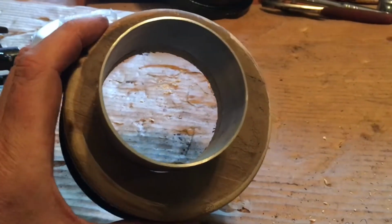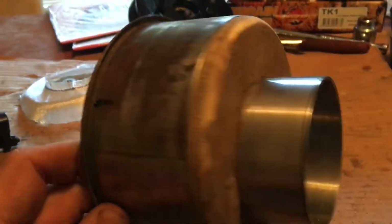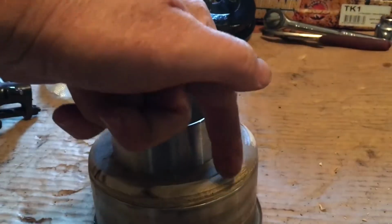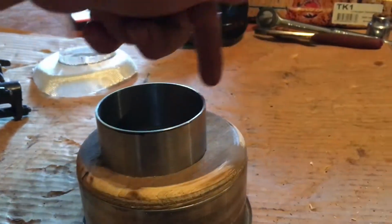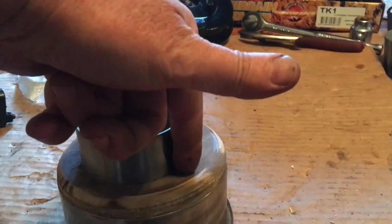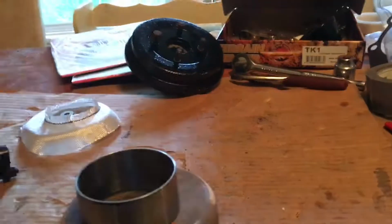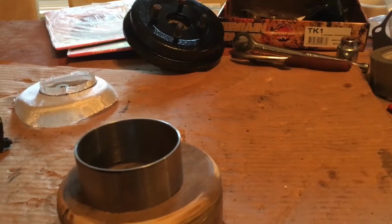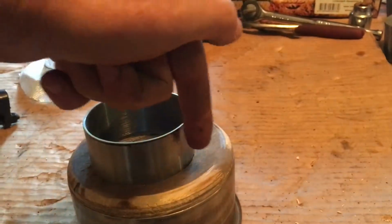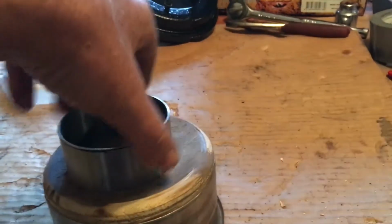One of the things that I did was mark the front. That's the front of it, and then I marked here and there. I'm going to use the two back bolts. There's 3 bolts to hold the throttle body. One here, one over there, and one in the front. It's not perfectly triangular, but it's close. This bolt here and this bolt here, I'm going to put, I guess, a 5/16 coupling nut down inside, and that'll be holding the throttle body, the TBI unit, down. Then I can thread a 5/16 bolt through the top in these 2 places to hold this fabricated piece down.